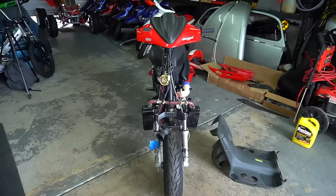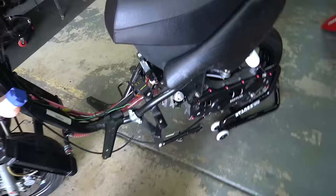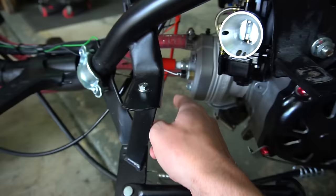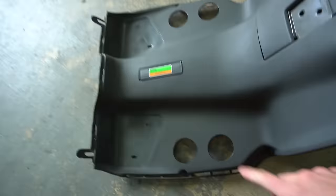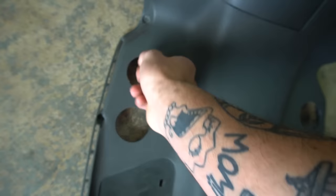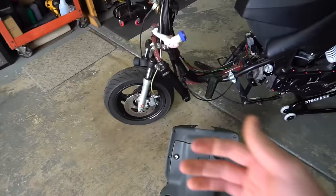That's a mess. All right, F12 being a little bit of a pain right now, but I got the coolant temp fix. We ran some Teflon tape on there and I just tested it out. It's good to go. There's nothing leaking from that. We're all good over here. Everything seems to be okay. I downjetted the pilot. I drilled a couple holes here for the back of the radiator just to let air through so it doesn't just run into the back of here. Usually on the liquid cool model, there's some fins here molded into the plastic and it has an inlet for air to come through, but we didn't have that model. So just went the easy route and drilled some holes in it, made it simple. Lets air through very nicely.